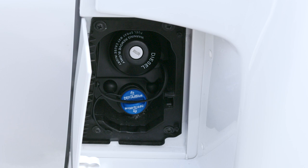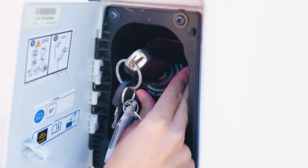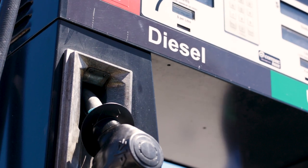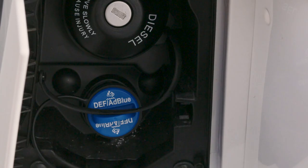The fuel flap is beside the passenger door. To unlock the fuel cap, put the vehicle key in the lock, hold the cap firmly in place, then turn the key anti-clockwise. Only refuel your motorhome with diesel. The diesel must go into the tank with the diesel label on the cap. Never add diesel to the blue cap labelled AdBlue, as this will cause major engine damage.